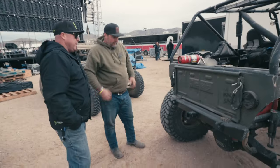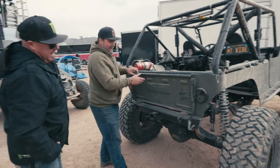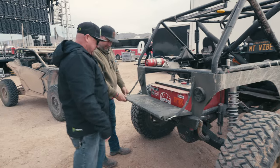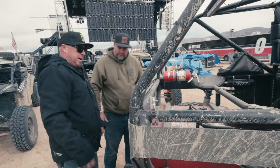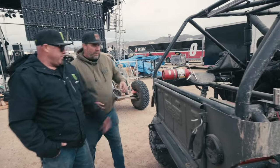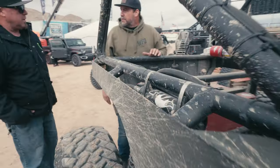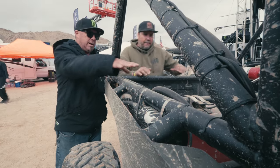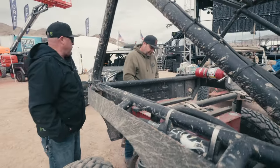Once you guys had the tube work done, I just wanted simple. Tell us about this — so this is a 1957 CJ5 tailgate. That's my kitchen right there. One thing I really like: here's the skin, and if you look right here, you've got some tube that just kicks out and holds the skin — that was Carlos's idea. It's an AMC Jeep with a Kaiser tailgate and all these new-school parts — a mixed-match deal. Running the Motobuilt three-sixteenths. Carlos did a great job on the fabrication for rigidity and strength. There's 22 gallons of fuel back here — enough to get back and forth through Rubicon.